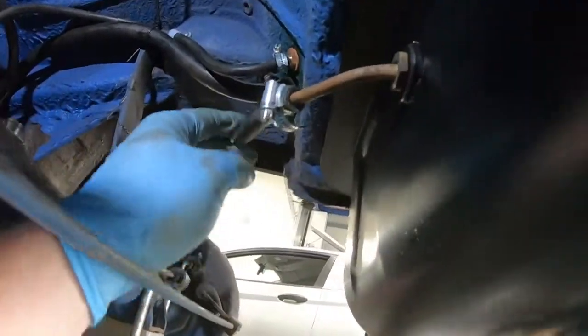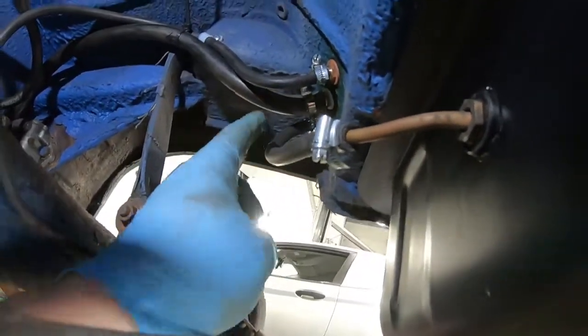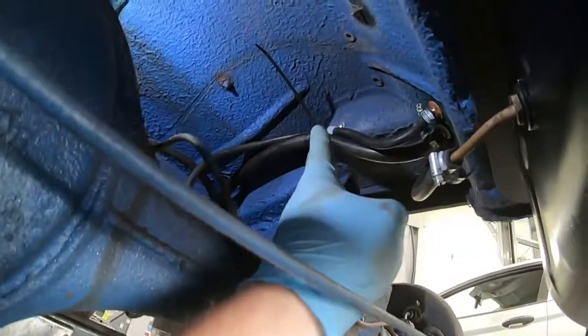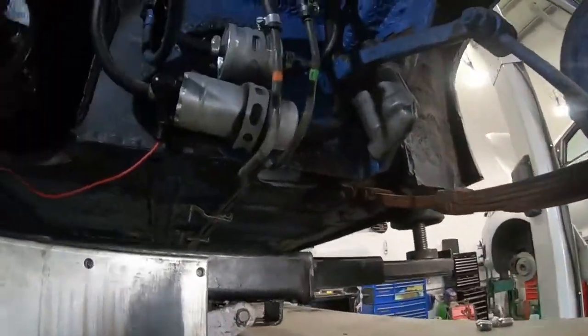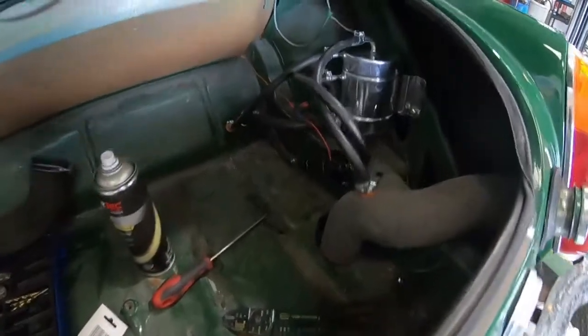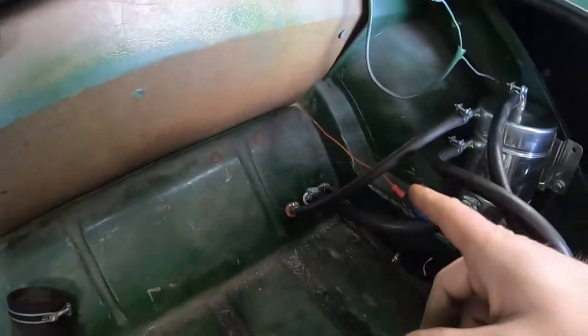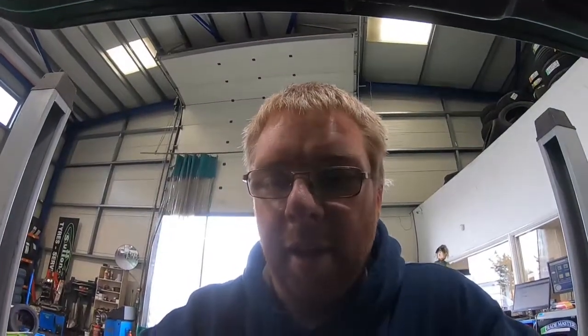We're all pretty much plumbed in. We've got our feed there into the low pressure pump, the feed down to the high pressure pump, and the return line next to it — quite happy with how tidy that is. Tank's in, all the wiring is in — this is obviously temporary. I've had a great idea for the holes in the dashboard for the heater pipe and the clutch cable — I'm going to put a toggle switch in to run the fuel pumps. The ground for the fuel pump I've literally just grounded out on the screw we used to fit it in.